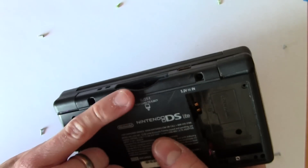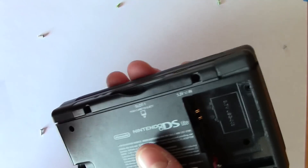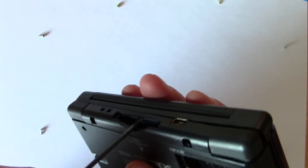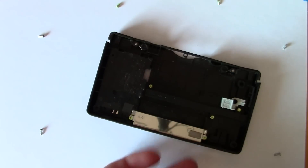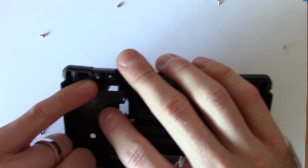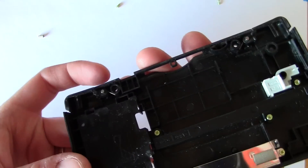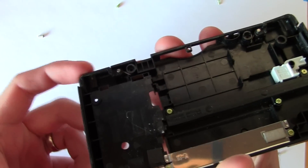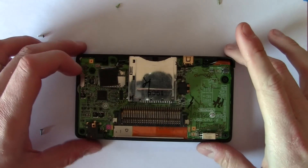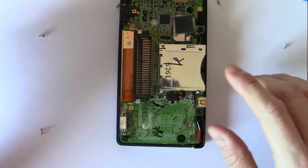Now I totally forgot a screw, and this is a lesson learned for both of us. If you ever start feeling tension when you're removing a part, don't keep going at it — there's probably something holding it there. I totally forgot that there's a tri-wing screw hiding underneath this spot. There's the inside of the back shell. Just a note: if the shoulder buttons pop out, they're simply stuck there on kind of a pin as a hinge, and they've got a metal spring that uses leverage resting up against that post where the screw goes through to hold the back casing on. Now, everything that we're going to be working on is actually going to be on this right side of the board.